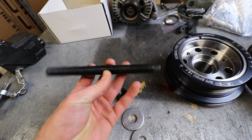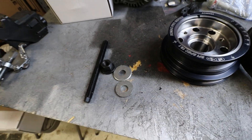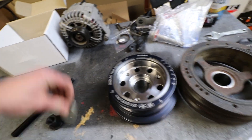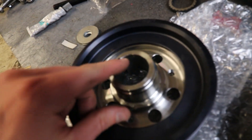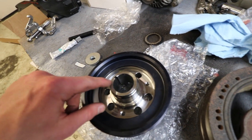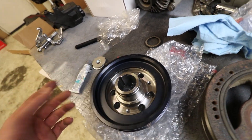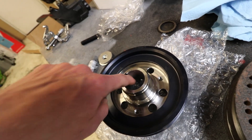To install it, I'm going to be using this balancer pulley install kit — it's literally just a chunk of all-thread, a bolt, and two washers, so nothing too complex. I'll put the link in the description below. You load this into the crank, then the pulley goes over it. Drop the big washer in, put the smaller washer on the outside, and then tighten her in and it will suck right up onto the crank. The pulley does have a notch in it. The crank is not pinned from factory — most LS engines do not have a pin in them. I am not putting a pin in it right now. I'm going to take some RTV and just fill that up a little bit to prevent any oil leaks, and always make sure you put the seal on the backside.